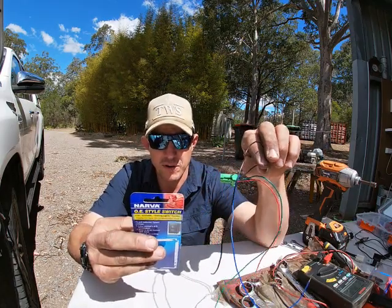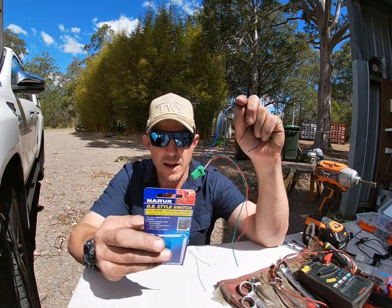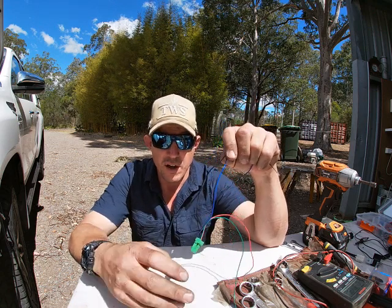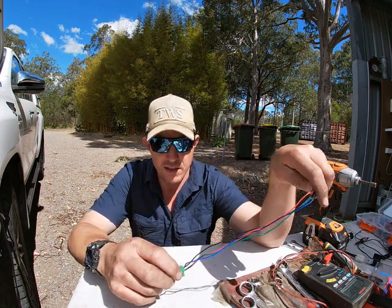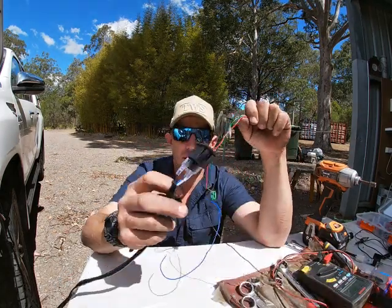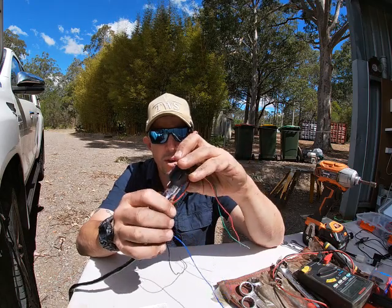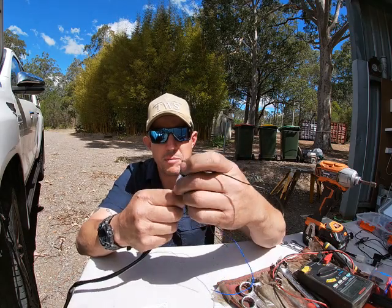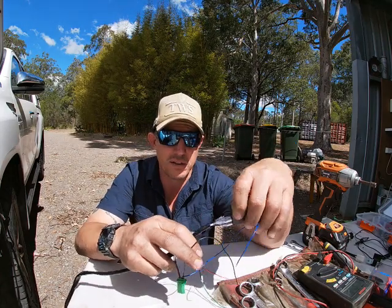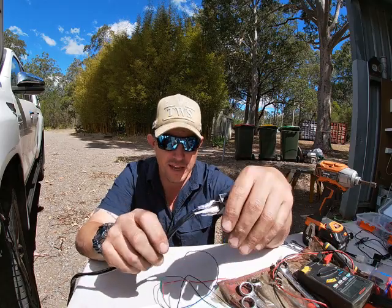On this one here, we're gonna wire that up, and then dash light is blue, so we're not gonna touch that for now. And red in and out, 12 volt in and out, is this red and green. Okay, so red and green are gonna be blue and white. Black is gonna be black and blue. If we can get in under there and pop one of those other switches out, we can piggyback off one of the other grounds in there.